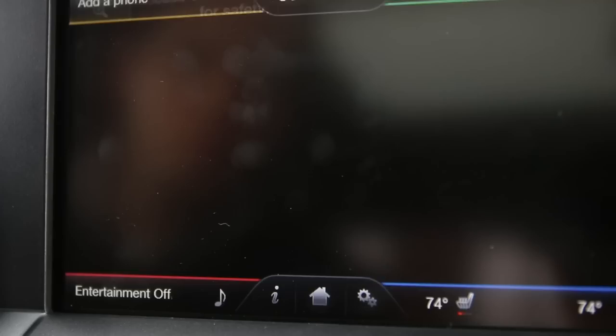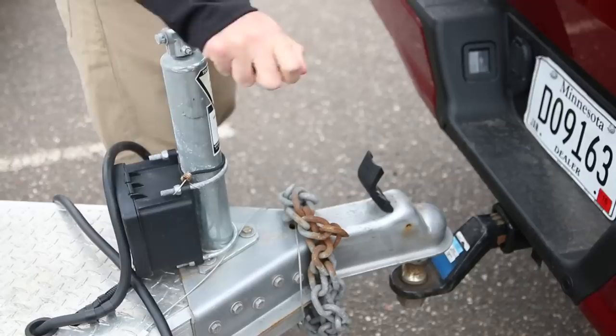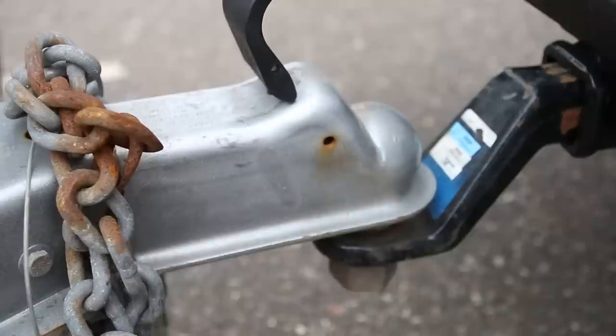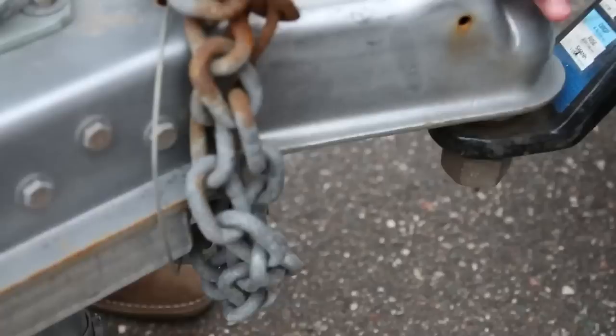You can see how close you're getting — just a little bit further back. Once you see it under there, we're going to go ahead and stop and put it into park. Now we're going to go check our trailer. On this specific aluminum trailer, the first thing we're going to want to do is flip this lock up and then start cranking the trailer down. Now that we've got it lined up, we'll make sure we drop the ball head right on there. We're going to keep lowering it and you'll hear it click in, and that wheel should start coming off the ground.